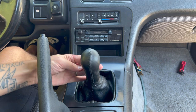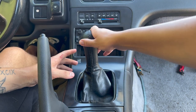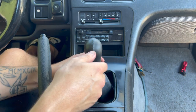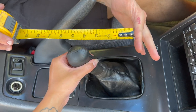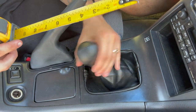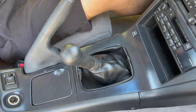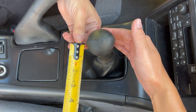That's so short! I don't know how I feel about this. It feels way better than OEM — way notchier for sure. The input is really good; when it actually goes into gear that feels great. Where's the measuring tape? Before it was like over at eight — that's seven inches. Now it's five and a half — that's honestly pretty good. That's a win. In gear it's only giving about half an inch of play even really forcing it, so technically it's a win.